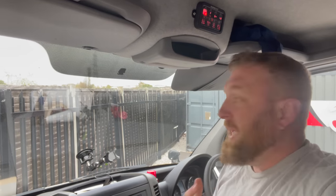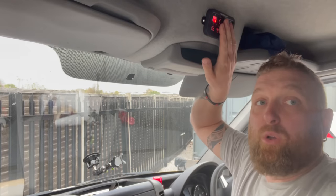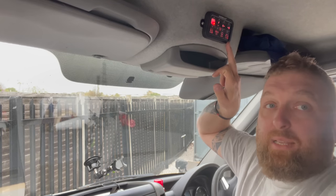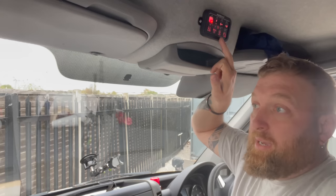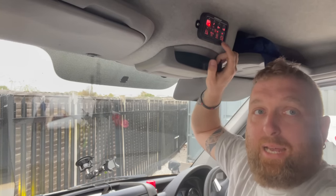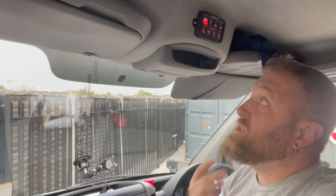And the beauty of this now is, although I've only got my front spots wired up to it, any accessory or any further lights that I wire on, i.e. the side lights, the rear lights, something like that, all I've got to do now is run the pos and the neg back to under the seat and wire it directly in, and the switches are already done. The other thing at the minute that I've done with the app is, because I've got the windshield light, which is the little pods, and I've got the grill lights, which is the big ones, I've actually linked them together. So when I press one or the other, they both come on. So you can see there, both lights come on. And what that allows you to do is just group things, which I think is also a nice little touch.